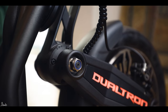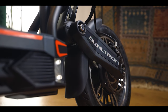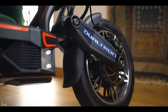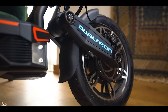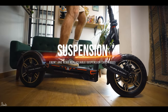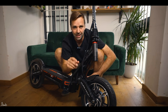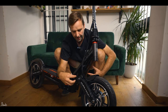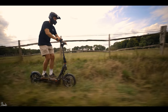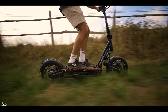What's different on this scooter compared to other Dualtrons is that with the big wheels you need much bigger swing arms. There's a huge swing arm coming up here and down from the stem. In here is the cartridge suspension — classic Dualtron suspension. Front and back can be replaced; it's a bit of a job. You have to take it apart and put a new cartridge in, but it is changeable, which is a really useful feature if you prefer a softer, harder, or medium ride.